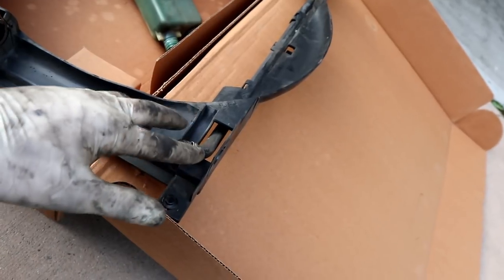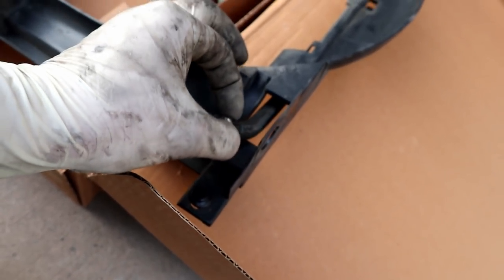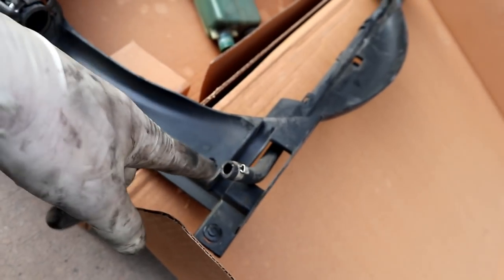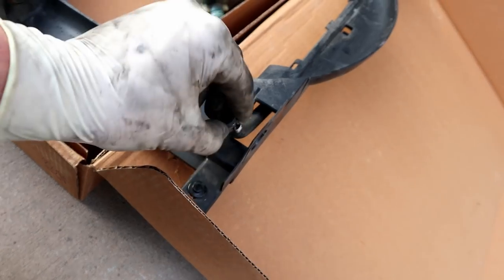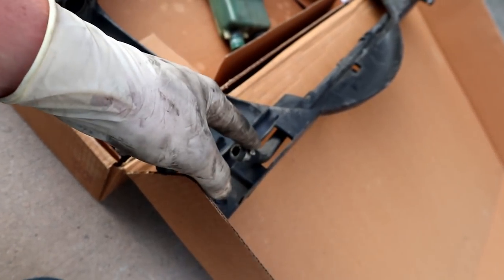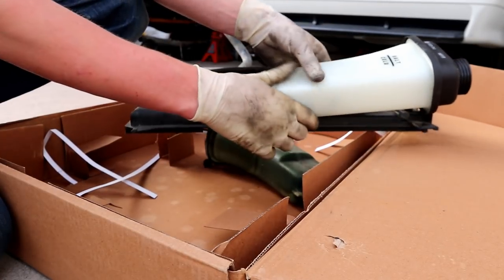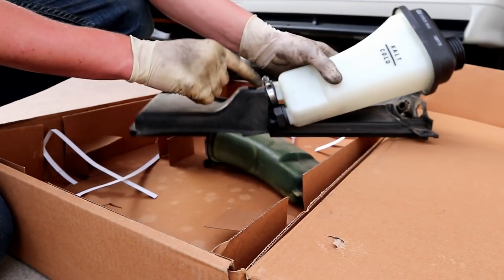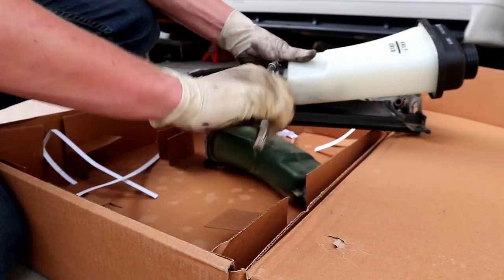So I'm gonna take some wire cutters, because I am gonna be reusing this clamp, and just sort of pinch the end of it to get it to stay tight again. You can absolutely replace this clamp with just a normal screw type clamp if yours is bad or you don't trust it. But in this instance, I'm not worried about them. They seem in pretty good shape. And make sure that the expansion tank is bottomed out on the hose. You don't want to set the hose like only halfway up.